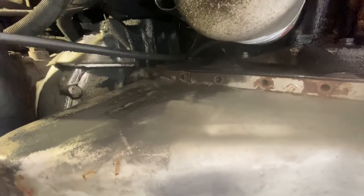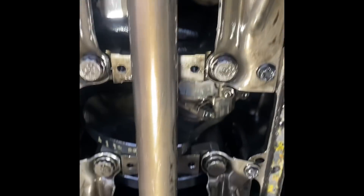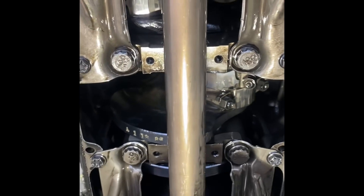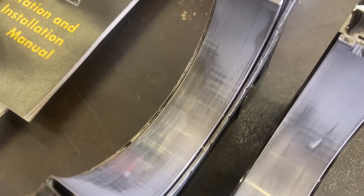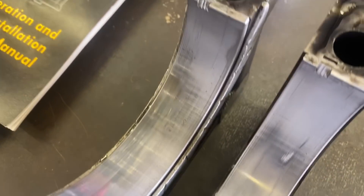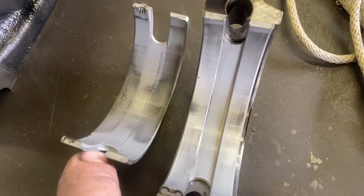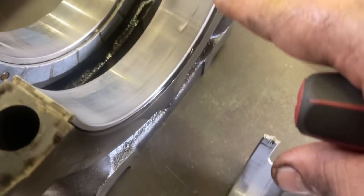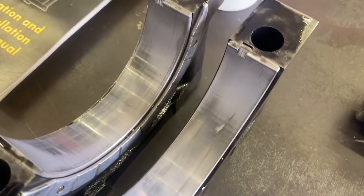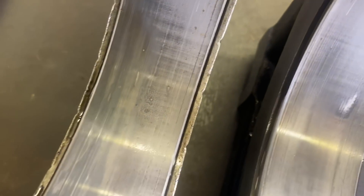A couple hours worth of labor — it's well worth knowing the condition of everything. Here's our inspection of two of the main bearings, and you can see the wear. Since we have it apart, we're going to go ahead and replace the rod bearings as well. This is the upper, which takes the abuse, just on one cylinder. These both needed to be loosened to take the stiffeners off. I'm not going to remove any more until we start replacing things, but we can go ahead and start ordering now. You can see there's significant wear — not to the point where they were worn out, but they've had some stuff go through them and are definitely worn.